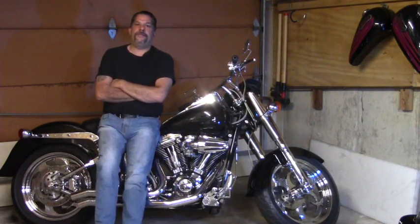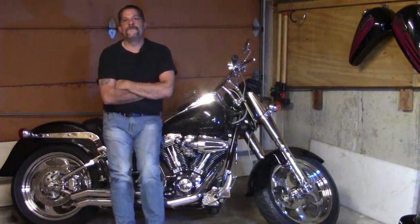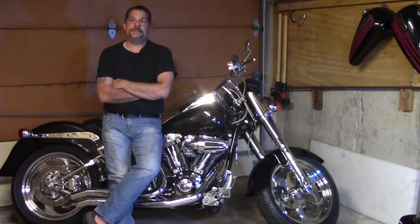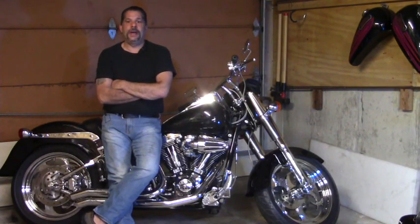When I'm running, I'm throwing a meter at the battery and it's reading 12 volts, when it was 13 plus before starting, which is normal. Well, if running it drops to 12 volts, sometimes comes up to 14. And that's Dennis. Well, Dennis, it sounds to me like you've got an intermittent charging problem.